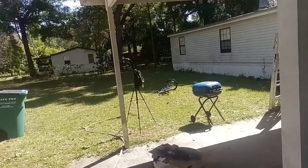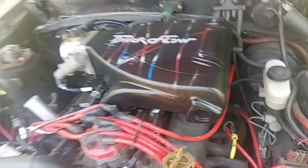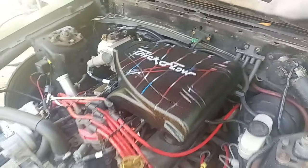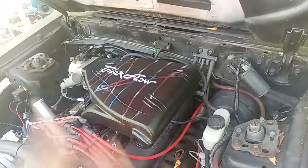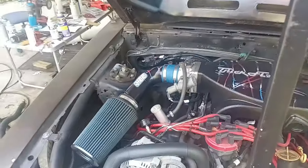Everything's done here. I decided to go ahead and paint the intake — it's not quite done but that's what it looks like. I have a little bit more to do to make it exactly how I want it, but the intake spacer is installed and everything is awesome. I did clearance those sharp edges around the bolts with a file and it seemed to help out quite a bit. When you set the intake down, keep it loose so you can lift it up to start the back bolts. The two on the inside can be a little difficult, so do them first — put the two middle ones in and don't tighten them all the way so the intake doesn't fall off completely.